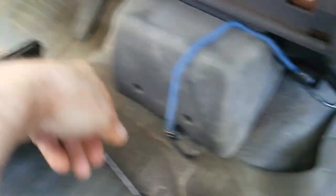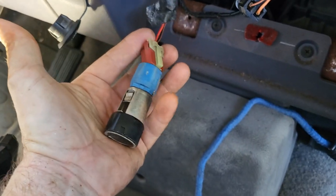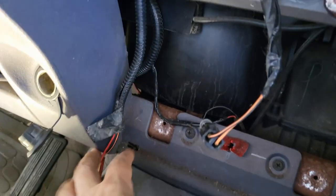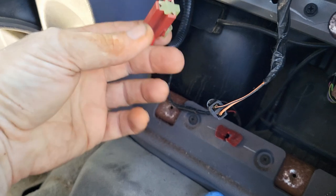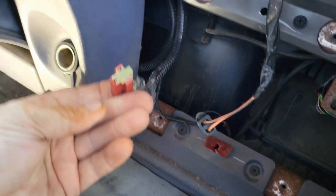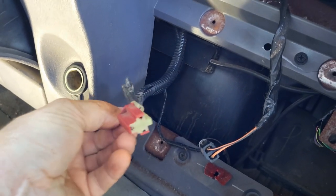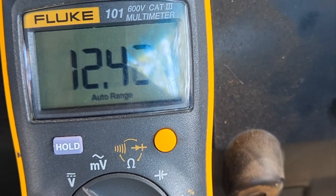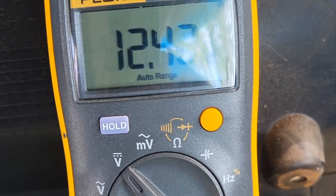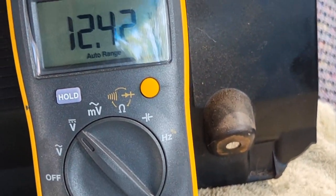Here's where we're at. Let's put these together — it was plugged in here. This is the one that goes up into this spot. I'm getting ready to run the wires to make sure they're good — they look to be in good shape. So I got the volt meter here, and I'm going to see if I've got 12 volts. Let's turn the power on — and there you go, I got 12 volts. So now all I've got to do is tap onto that and seat it into that hole. This turned out a lot easier than I thought it was going to be — or maybe I shouldn't have said that out loud.